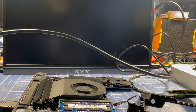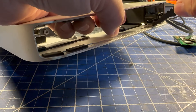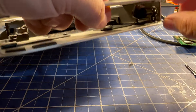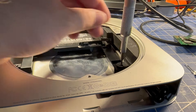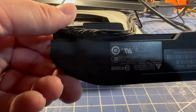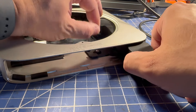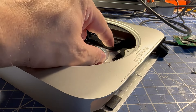We can take these components and put them back into the case, but we'll need to swap the power supply out for this known-good power supply. So we need to get this power supply out. There's a little clip here we need to pull out, and then the connector itself you can turn clockwise. That frees that up. And then there is a Torx screw here which we need to take out. With that screw out, we can pull this black plastic piece towards us and that allows the whole power supply to slide out. This one is no good, so we'll take our known-good power supply and slide it in.